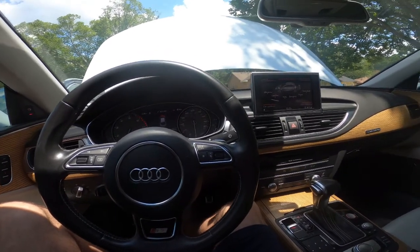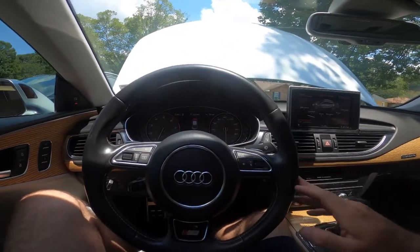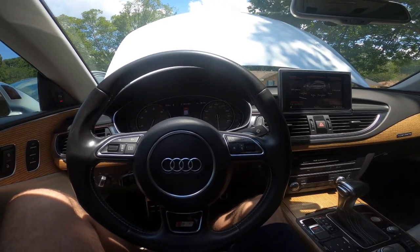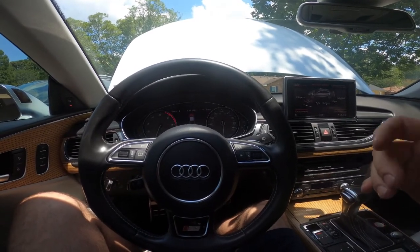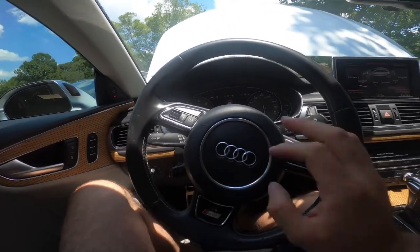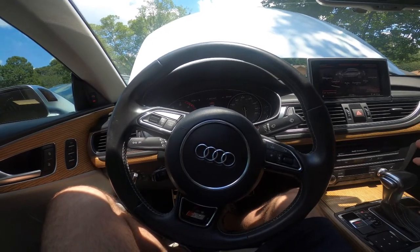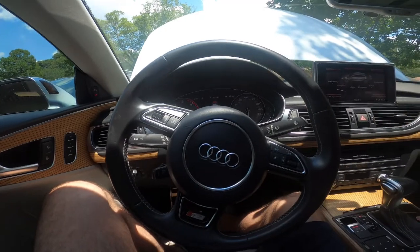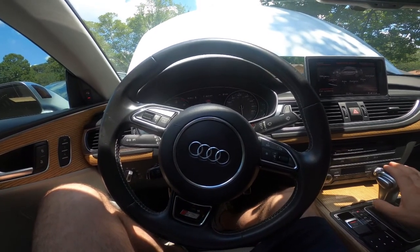It's pretty neat. Another thing was when I turned the steering wheel, I would get an adaptive headlight fault. Pretty simple. I'll walk you through how to fix that as well. Some other things I'm going to do is I'm going to enable the assisted steering and the lane keep. This car does not have it, but I have the control modules in the car to where if I change out this column here, go into VCDS, I can actually enable that. I'm going to be doing that.